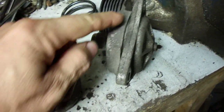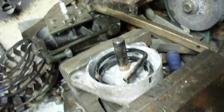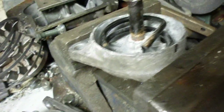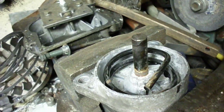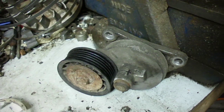I thought it was something with the outer area seizing up, but when you get it apart you can see the spring sits in there and doesn't come anywhere close to the side. It's all just the shaft — it doesn't even want to go back on yet, it's still so tight. I'm hoping that drilling a hole and using penetrating oil will free this one up. My son suggested spraying inside the hole with Jigaloo, fluid film, or something similar just to keep it lubricated. That's a suggestion for anyone with these tensioners — you might want to drill a lube hole in them.